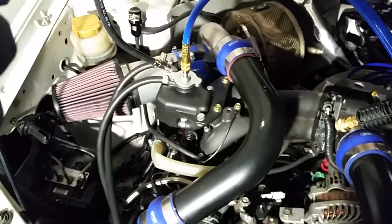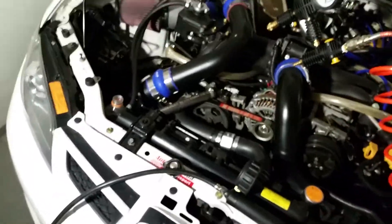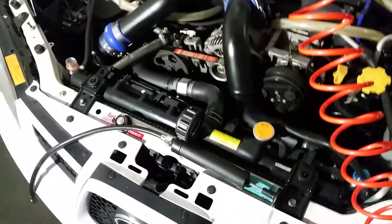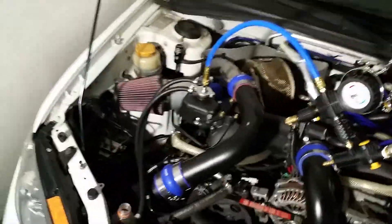It held the pressure — I waited like three or four minutes and it held it. One reason to do that is to make sure all your hoses and everything are connected. You can also test it for head gasket leaks. I'm doing this because I changed out the thermostat — I had no thermostat, was running distilled water. Now I'm putting in some Subaru mix and I put in a thermostat yesterday, so I need to test everything.